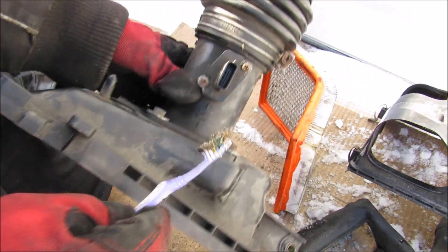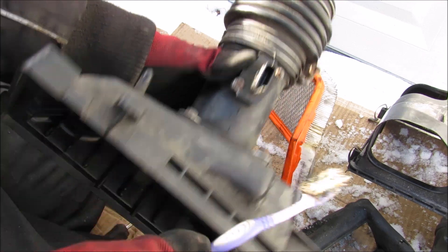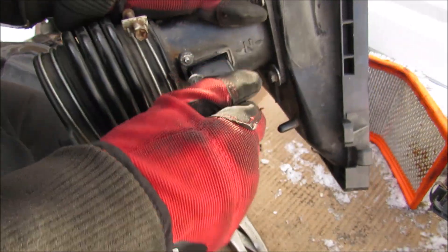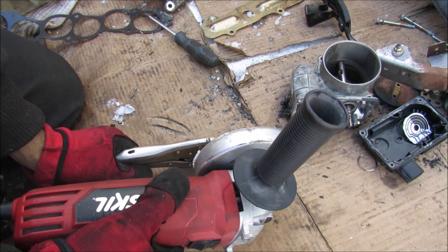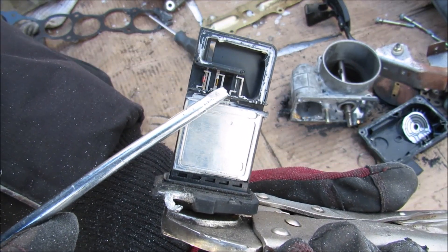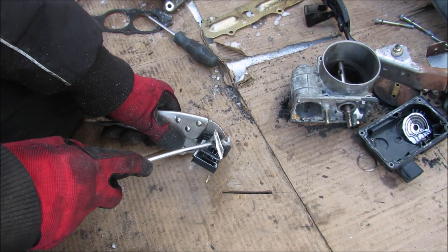Next up we have the collector where all of the air goes into this fixed section. We've got the mass air flow sensor inside here, which measures the amount of air. We're going to get a closer look at what the mass air flow sensor looks like and then cut it open to see what's inside. You can see there are two small resistive elements as well as a temperature bulb. I'm just going to pry up this little cover to reveal the circuit board inside.